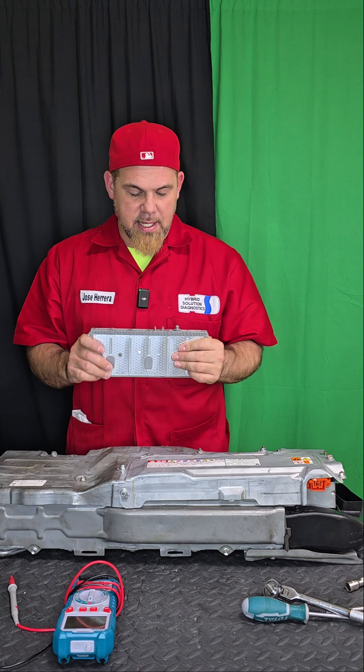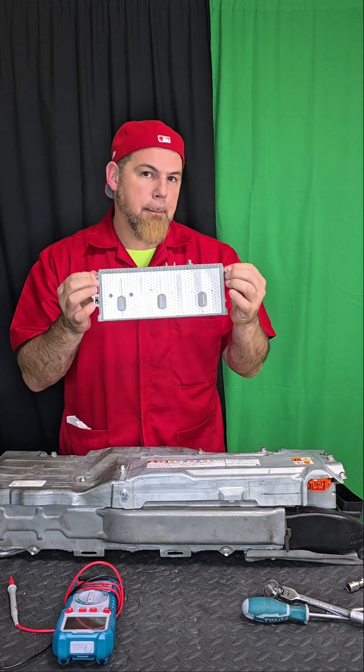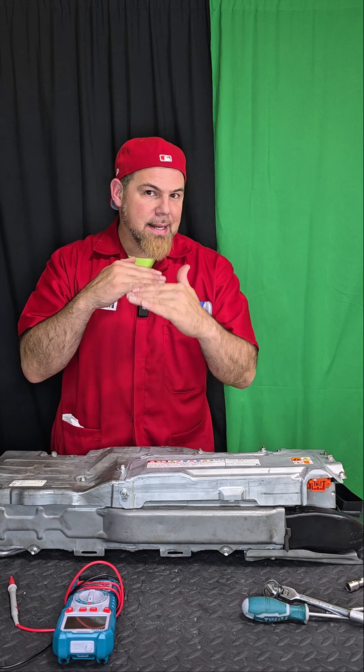Let's take this battery apart and explore Toyota's new bipolar hybrid battery. For many decades, Toyota has been using nickel metal hydride modules with six individual cells, valued for efficiency and corrosion resistance. Now they're still using nickel metal hydride, but in bipolar modules — plates directly connected in series with absolutely no external connection between them, creating a high-voltage battery.